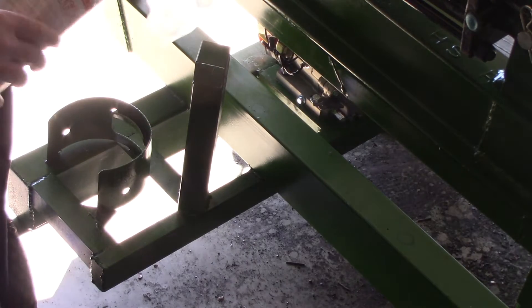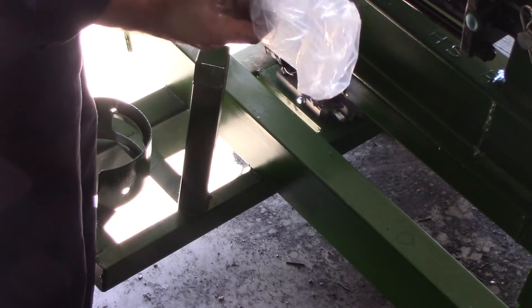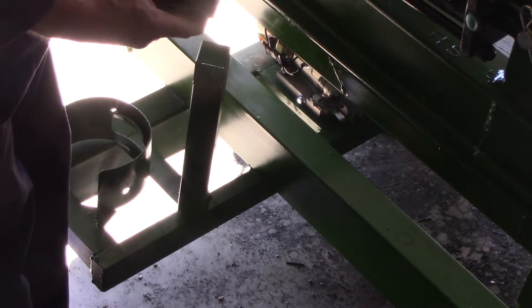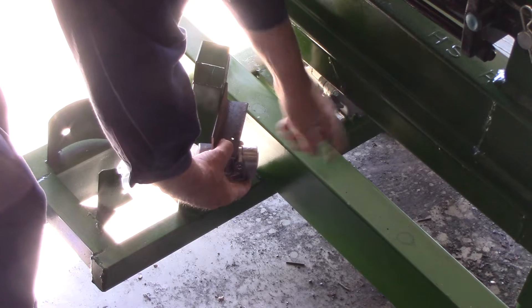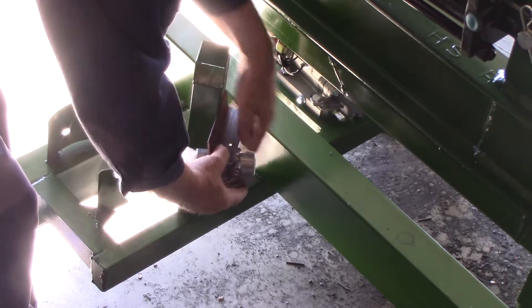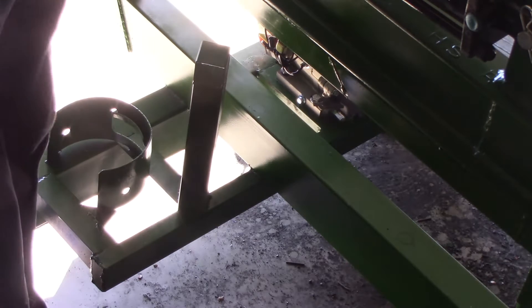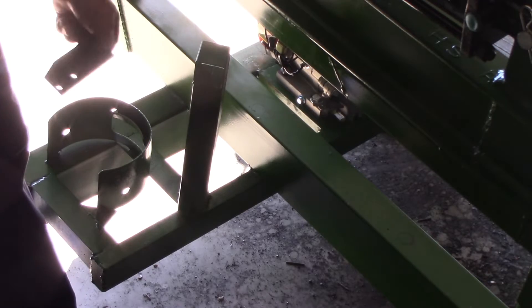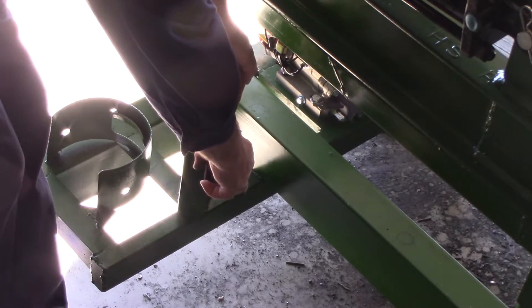This is the oil filter I have to put on here. In order to mount it, it has a couple of screw holes in the top which I don't have bolts to fit — probably some metric size which I don't stock, so I've got to go and get them. I've drilled the holes already and I'm going to weld that bracket on. The pipe will come back in under here for the return plate and then back into the hydraulic tank. This bracket isn't in the plans because it's very dependent on how you design your hydraulic tank and what oil tools you end up using.